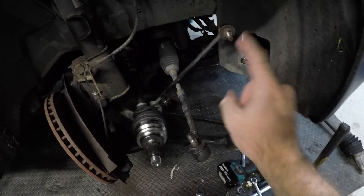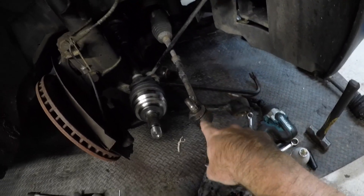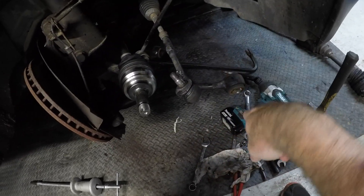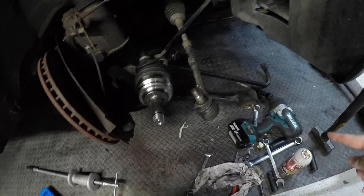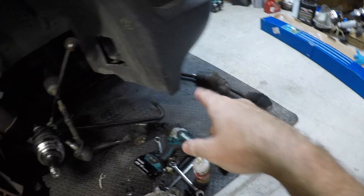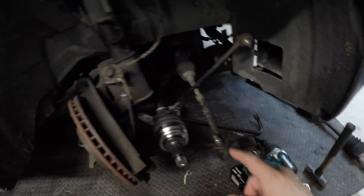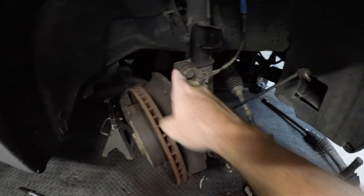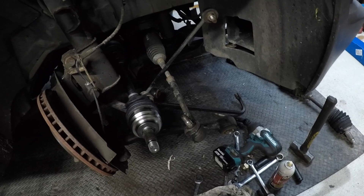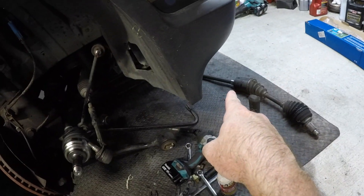Here's everything apart. Like I said, we just pulled the sway bar link, pulled the tie rod — that's a brand new tie rod and it's already getting a cracked boot on it — thrust arm, the bushing on the thrust arm still looks good. I mean, if you have a really big slide hammer it's not that hard of a job. Without a slide hammer you can't separate it at that joint — if not, you have to take the big aluminum skid plate off, get on the other side, and usually take a small pry bar or a chisel on the lip right there and hit outward to get the pop out.